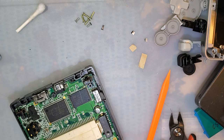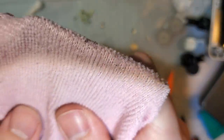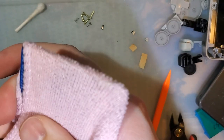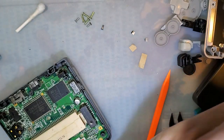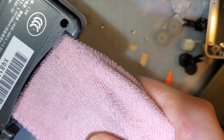You could use a driver's license or your credit card — just don't use either one on a video you're filming to put on the internet. Wrap it in a cloth. Then take a microfiber cloth, saturate the end with some isopropyl alcohol, and you don't even have to take it apart — just stick it in like that.